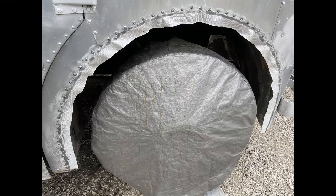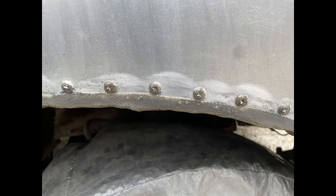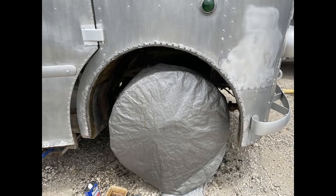On a recent project, in order to seal the edge on a wheel well, I had to apply this process with fiberglass attaching to the aluminum. This is the initial phase when the JB Weld is still liquid. This is the following day — the JB Weld has kicked off, the fiberglass mat is bonded to the aluminum, but not as firmly as it will be with the fiberglass resin. I'm about to apply the fiberglass resin and seal this edge of the wheel well. Here you see the fiberglass resin has been applied — it's now about two hours old and it's a very nice edge. I was able to position it because the JB Weld didn't kick for a long time. The finished wheel well is looking very good — a good, durable repair that's going to last for years.